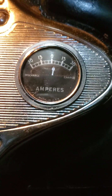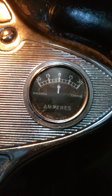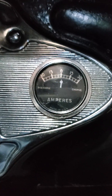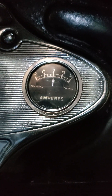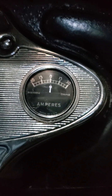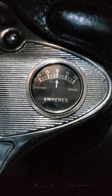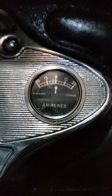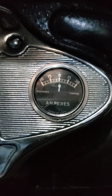So there really is a great improvement. They really save your generator a lot of wear and tear. It keeps them from getting really hot, having to run at high amperage. You can just leave it set at its lowest setting all the time and it just runs like a trickle charger on your battery. And even with the headlights on, taillights on — I've got LED taillights also.